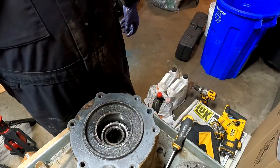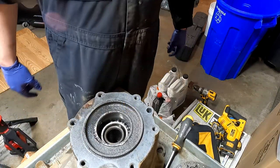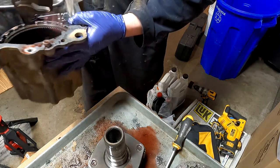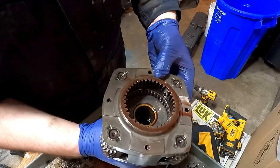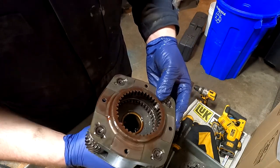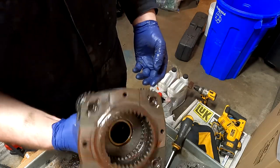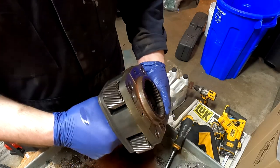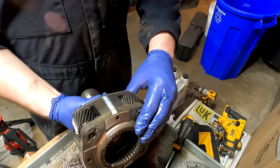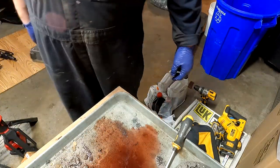The shaft fell down into the hole, which means we can now pull the case off - and there is our planetary gear set. I want to say something very important about this thing: this is NOT a serviceable part. If you find that your gears have undue wear, you have to replace the whole entire thing. I know there are people who have attempted to service these things and they failed miserably, and this is not an inexpensive component to source. My best advice is to just set this off to the side.